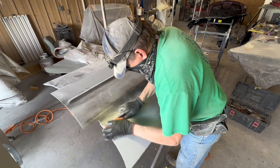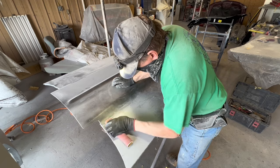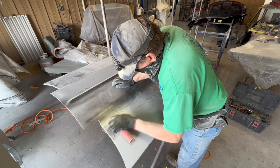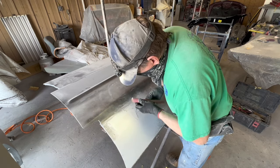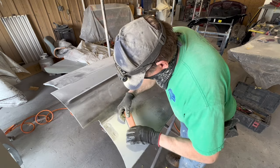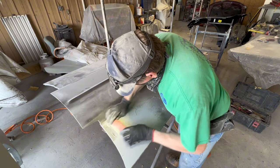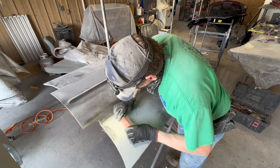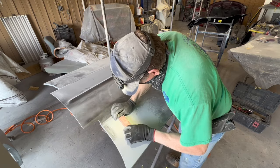And even though from the back to the front, it looked like it didn't have a wave in it, well, you look at that 8-foot fluorescent light in that reflection on that panel, and it won't be straight. It'll be going along and then dip down and back up, and just generally, you know, widen out. The fluorescent tubes will be going along, and then all of a sudden they'll get further away from each other in the reflection and then come back together. That's the horizon.